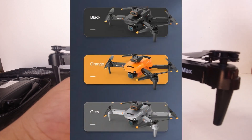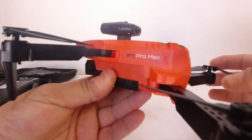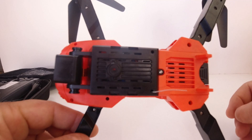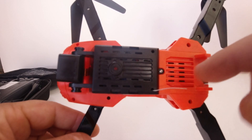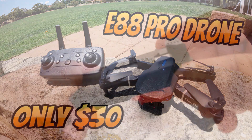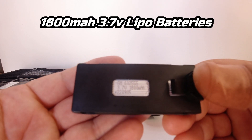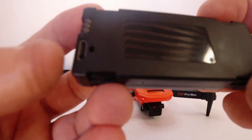You can get this in three different colors — orange, black, or gray. On the side here it says 'P7 Pro Max,' that's the name of this particular quadcopter. The Wi-Fi FPV module is on the bottom. This does not have an SD card — much like the E88 Pro it is Wi-Fi only. There's a little antenna, some ventilation, and the battery just pops out. We have three batteries, identical to the E88 Pro, so you can use them interchangeably. These are 3.7V 1S LiPo batteries, 1800mAh, in a modular casing with a micro-USB charging port.